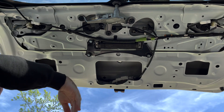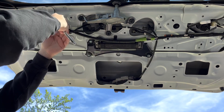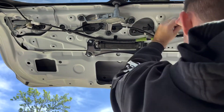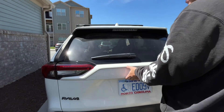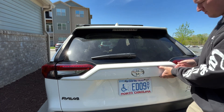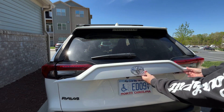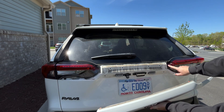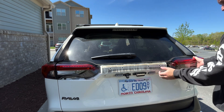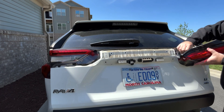It's better to do this upside down because if your hatch is closed and you're sitting inside, the bolts may fall down. Now lower your hatch — you should be able to just pull this panel right off. Just give it a little pressure because it is in there pretty tight. As you can see it overhangs the housing; that's why you have to take it off because there's a bunch hidden behind this panel. Then you should be able to just pull the light out and disconnect your wire.